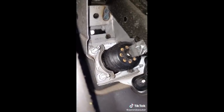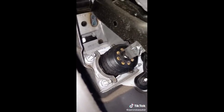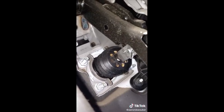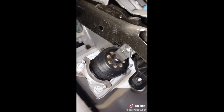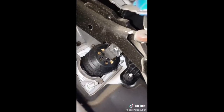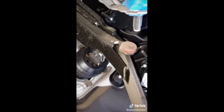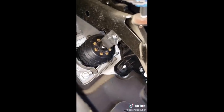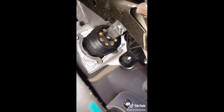Quick explanation of what's going on here: this has what's known as vacuum boost brake assist. When you push in the pedal it pushes in that plunger, but if we have a leak — hear that slight hissing sound? If I push really hard, we start leaking vacuum and it causes that squealing sound, and it also hinders brake performance.